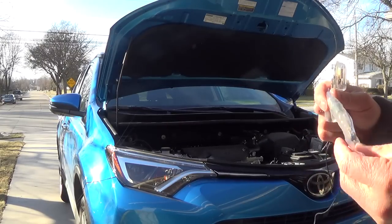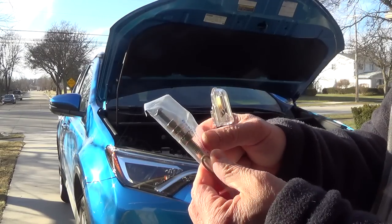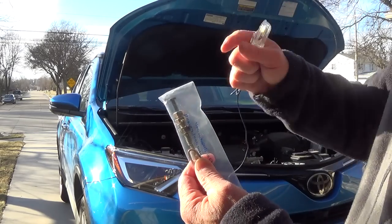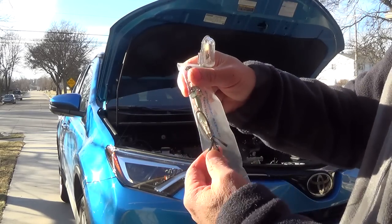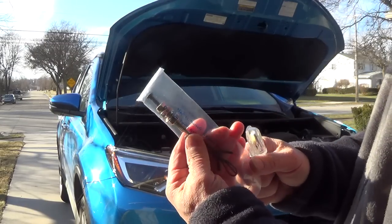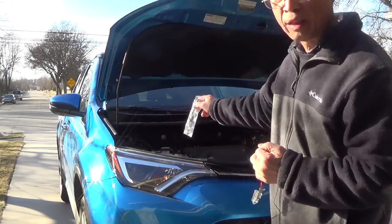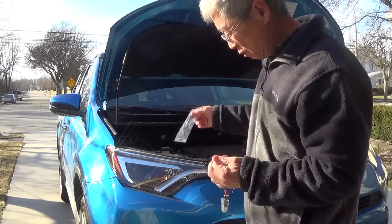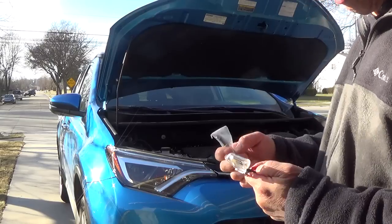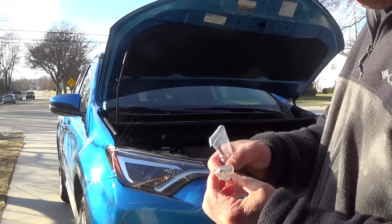This is the hood switch. It comes with the DC3 for protection. When the hood opens, it disables the remote start. But this looks ugly. It falls somewhere. I might have to make a bracket. So instead of using the hood switch, I bought a ball bearing tilt switch.